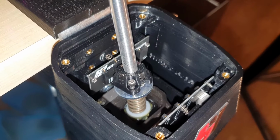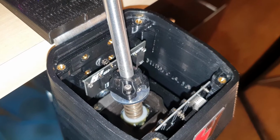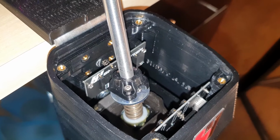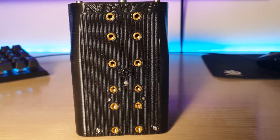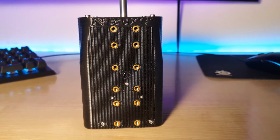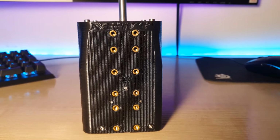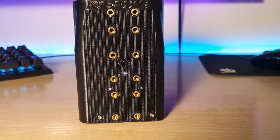However, the parts that have to withstand forces from use are metal, including the shaft, the screw holes, the screws themselves, and the spring mechanism, which gives the impression of a well-thought design, with the product's lifetime in mind. The various mounts of the shifter are composites of plastic and metal with the same design philosophy applied, where all the areas that withstand forces are metal and only the covering parts are plastic.